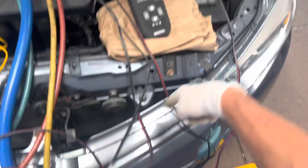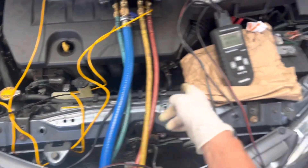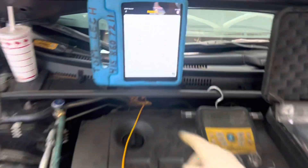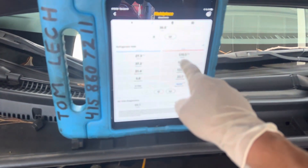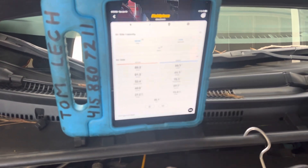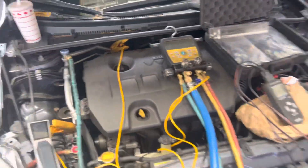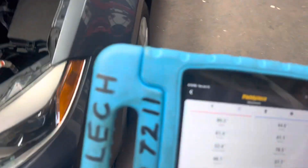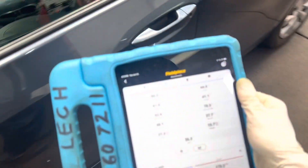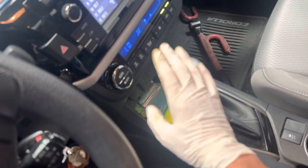The signal is going through here and we are just reading what is being commanded to the compressor. And here are the pressures right now: 27 low side, 179 high side. Temperature out of the dash is 44. So I just lost the cap down to the floor. Let's turn this down to minimum fan speed — very little load on the system.